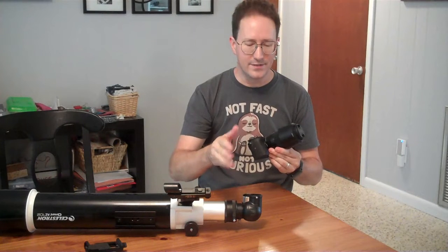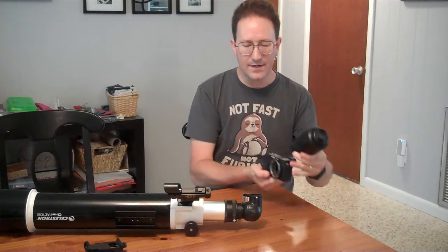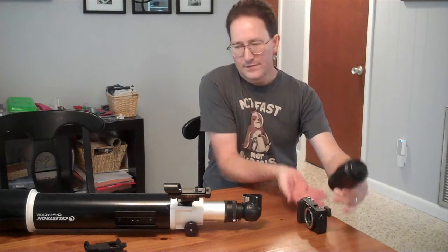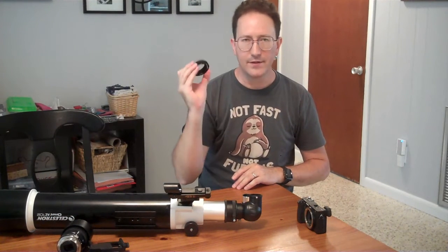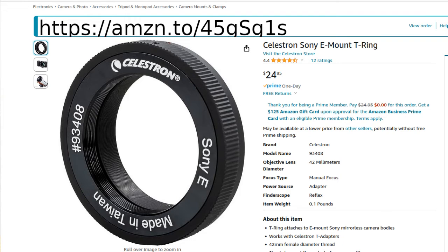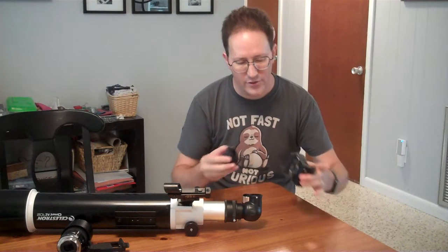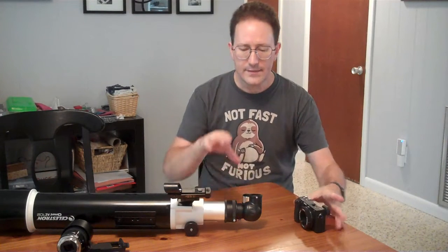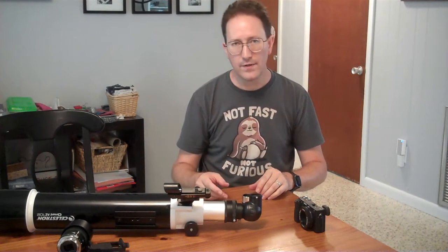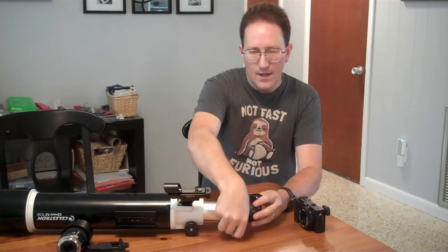So you can make these work. It has to be a detachable lens camera, so you're already looking at a kind of expensive camera, and you need a couple of adapters. On the camera side it's going to be very specific — I have an E-mount Sony camera, so you need the adapter that is Sony E-mount. One side will be the Sony E-mount, it will look like a Sony E-mount lens and attach exactly like one, just click in place.